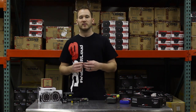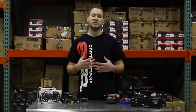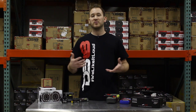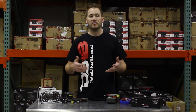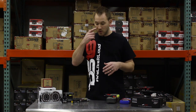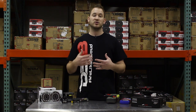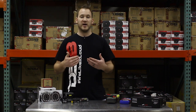One of our main issues is people looking for bigger and better tweeters to add to their systems to get those very high notes and make their system as loud as possible. But in doing so, they're hooking them up to amplifiers or a factory radio, and then a day later the speaker's blown. It's really important to make sure the frequency of the amplifier or radio is adjusted correctly, or make sure you have the correct crossover to filter out those bad frequencies.